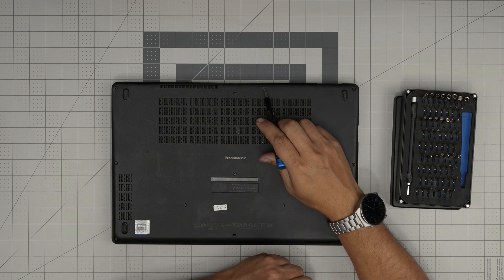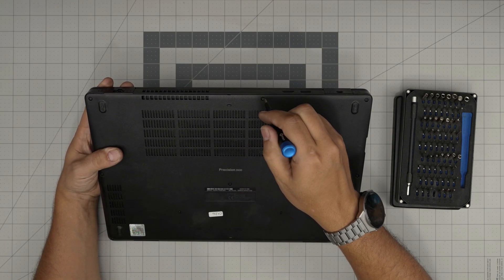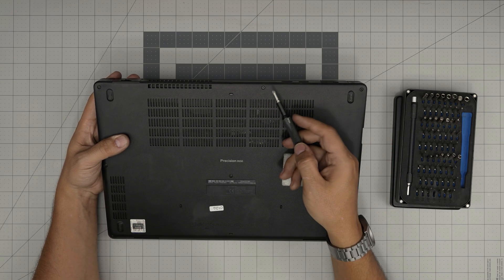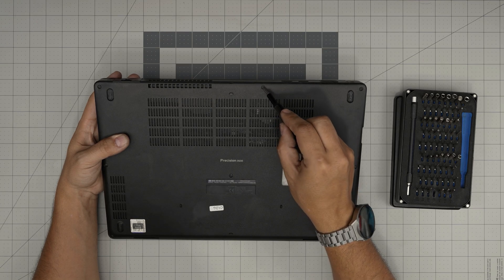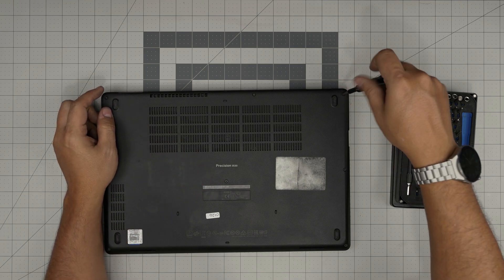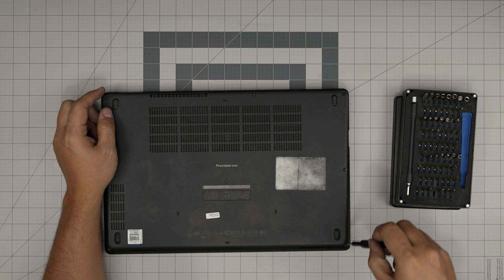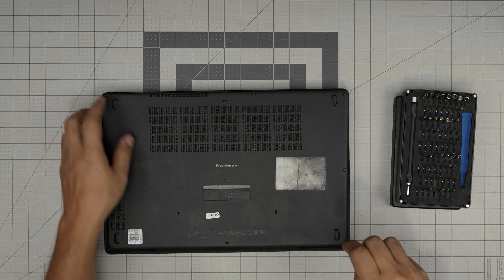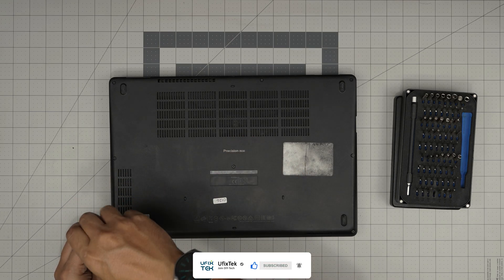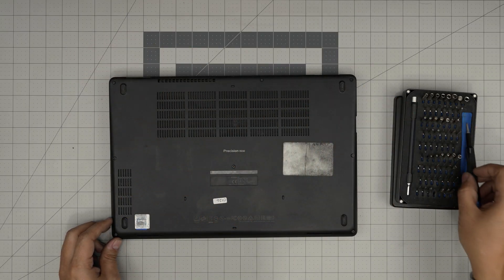I can see that somebody previously opened it and tried to remove a screw but used the wrong bit and damaged the screw head, so go slowly. All the screws have a C-lock on the other end so they won't come out entirely — you just have to loosen them. Loosen up all the screws including the one in the middle, just rotate until they become really loose. If you find these videos helpful, please click like and subscribe — it helps motivate me to make more videos and take requests.